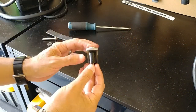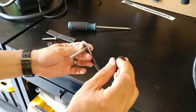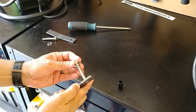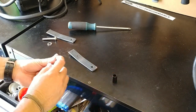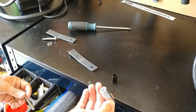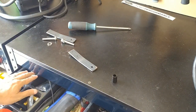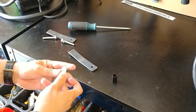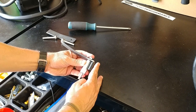So this is the original idea for the anchor point — it's basically a 3/8 spacer, a thick-wall steel spacer with an M8 by 40-millimeter stainless screw and a flat washer. We need a gap, and rather than outsourcing a longer spacer, I have some connecting nuts from my door straps that fit perfectly on the M8. With a longer screw, that should raise things up about half an inch. Let's give that a try and see where we are.